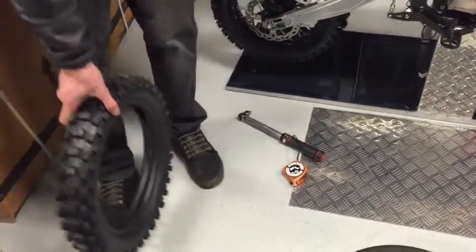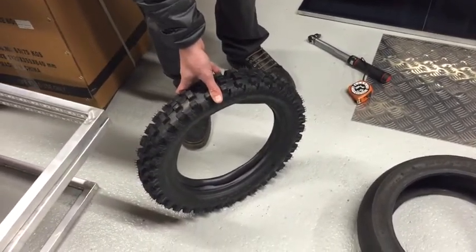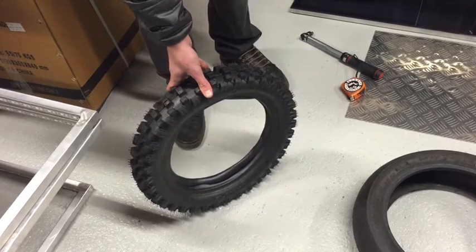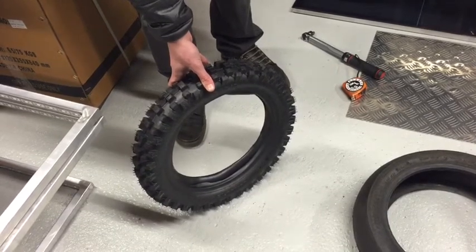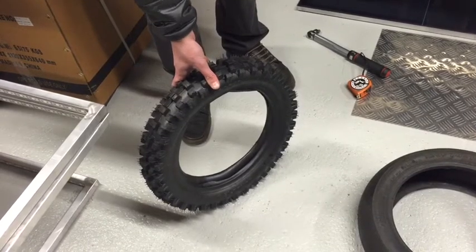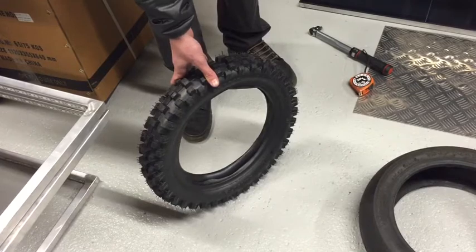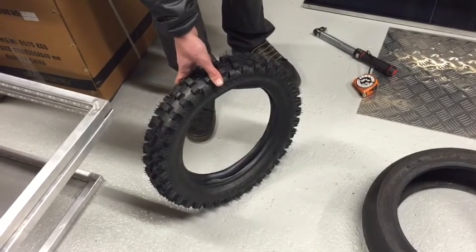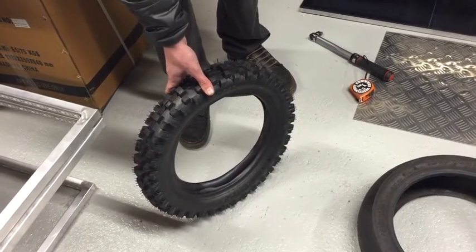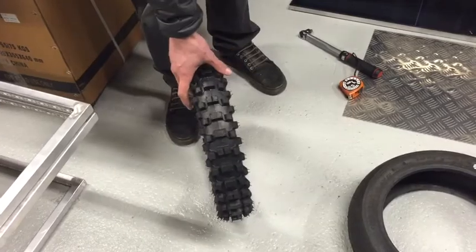The only other way to get around it if you don't have a rim lock is to pump your tyre up to 25 psi. If you pump it up that much, it shouldn't normally rip — but that kind of sucks, because if you want to race, you're not going to get as much traction as the guy running 10 to 14 psi. The flatter the tyre, the more traction you're going to get in the dirt, especially in the mud. So if you want to race, pretty much you need a rim lock so you can be competitive. And that's probably it about the tyres — thanks for watching.